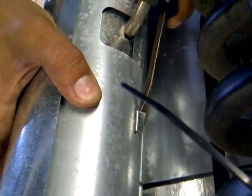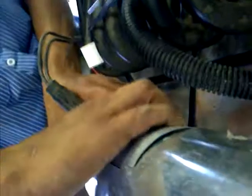Our heating element is guarded by this little door and this little flap. You can take the screwdriver, stick it in here and flip that up, pop your door, push it up and out comes the whole door. Then all of this stuff will cut you. Come in from the other side. You've got to quit using your fingers. Can you compress this tube and make that little thing flip out of there? This little door has two notches — one's the deep side, one's the shallow side. That will allow you to go all the way up and then lock it into place.